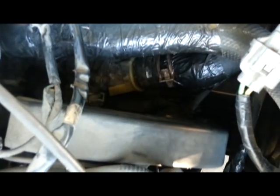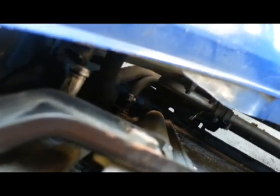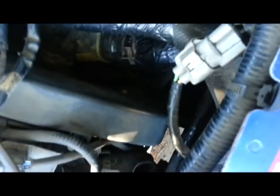Finally got this hose off, as you can see. Disconnected it. It was hard though. This hose down there, the big one, is giving me trouble. I need to unhook it, and the small one down below is giving me a bit of trouble too. And then the electrical connectors, I'm not sure how to unhook them. There's two of them, one there and one here, but I'm not sure without forcing them how to disconnect them. After I've done that, I can pull the radiator out, I think.